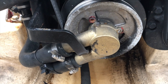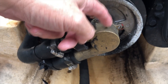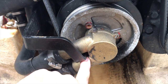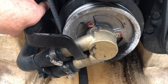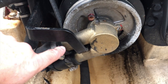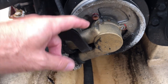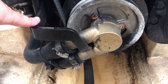We're going to try a little experiment - I'm going to attempt to cheat a little bit. The impeller sits right inside of this little raw water pump - you can see it's crank mounted. The screws are pretty simple: there's one, two, three, and then there's one right between these - that one's going to be the challenge. Normally to do this, you have to remove this bracket, there are a couple of screws up in here not very easy to get to, and you remove the hoses and pull this thing off, turn it on its side, and replace the impeller. It's a real pain in the neck - a little bit of boat yoga to get in a position where you can see that.